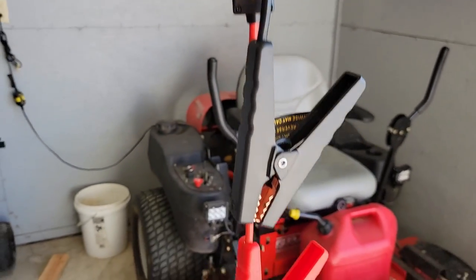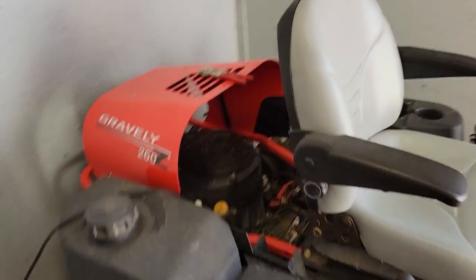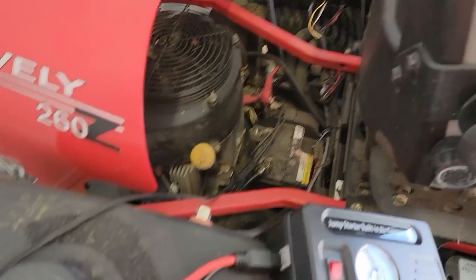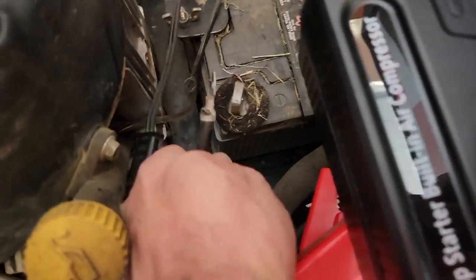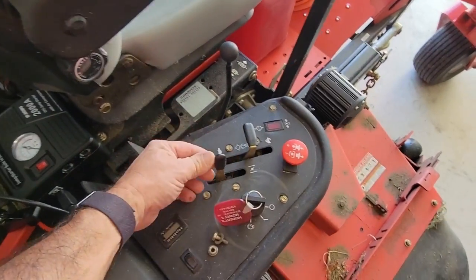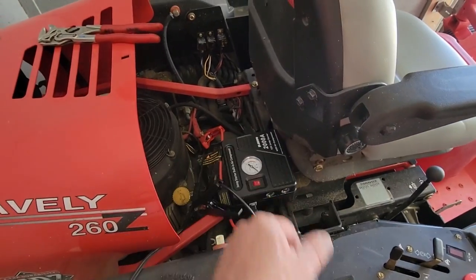If you notice, the cords are purposely built so they don't clang into each other — one is made a little shorter than the other. I just don't 100% believe the amp readings, so we're going to test it on the lawnmower. This is a 25-horse Kawasaki — I have not choked it, have not run it, it's perfectly cold. We unhook the ground wire right here, clamp it on the positive just like on the truck battery. Let's give it a little gas and choke it all the way.